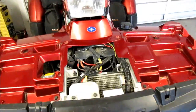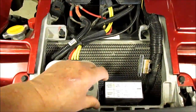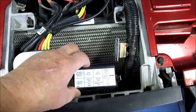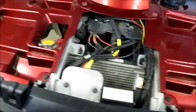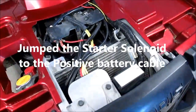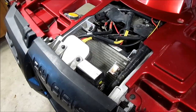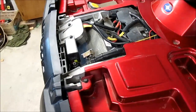I went through everything to check and see what could be the problem. Checked the fuses and everything seemed okay. I checked all the relays and everything seemed okay. Finally, using jumper cables, we jumped the starter and it fired right up. I ran for a couple miles heading up out of this gulch and overheated and the radiator fan quit working.